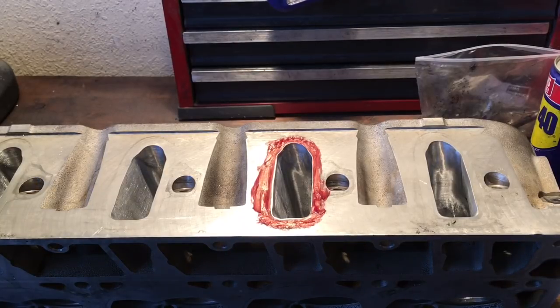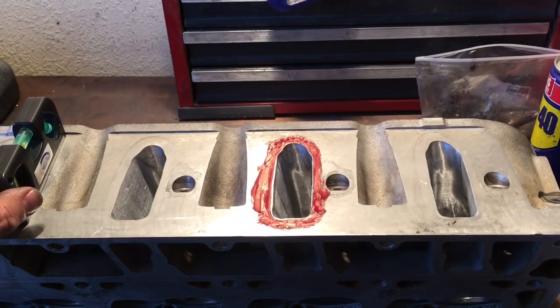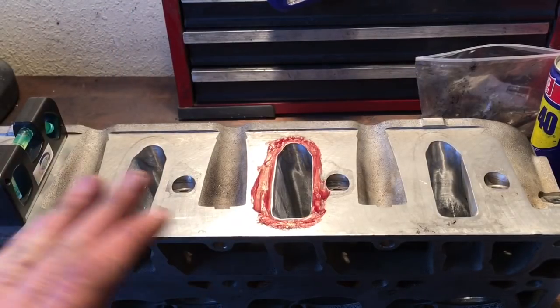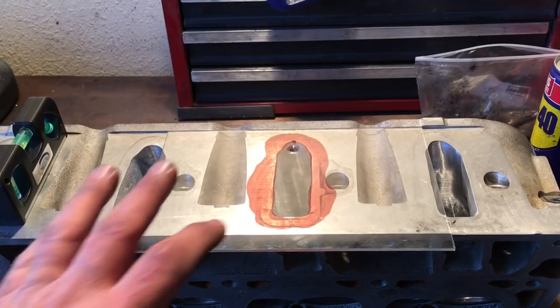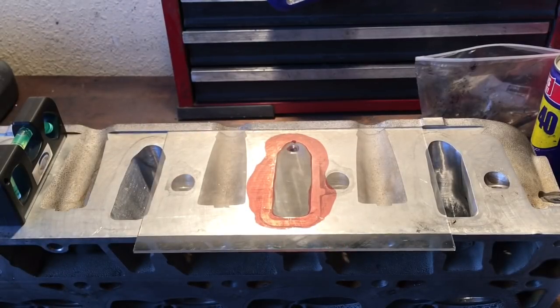Basically what I do is set the head up on the bench using one of these little handheld levels. I set the head up so that the bubble is slightly elevated — you want this half of the head to be slightly elevated so that your air bubble will run to the top of the port. I went ahead and used red high temp tack grease this time so it's easier to see in the video. I put a small amount around the port, then lightly press down on the plate to make a good seal between the plexiglass, Lexan, CD cover, whatever you're using, to the head so it doesn't leak fluid out.